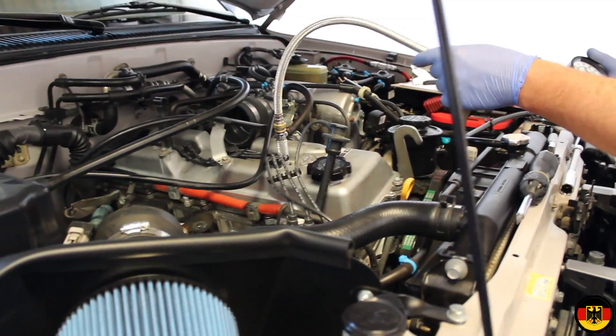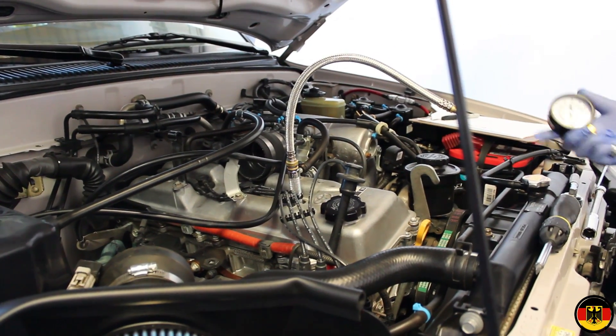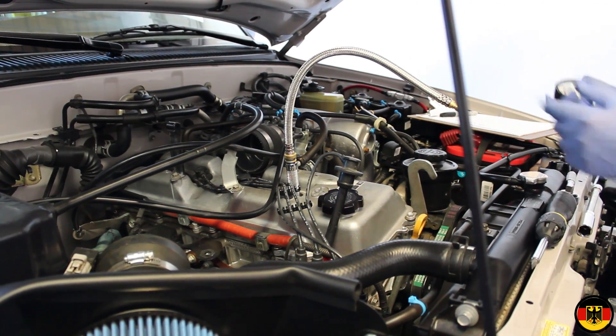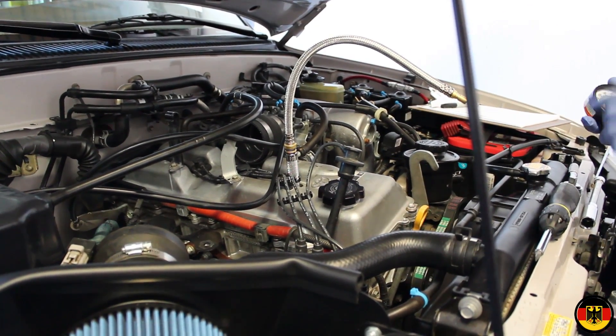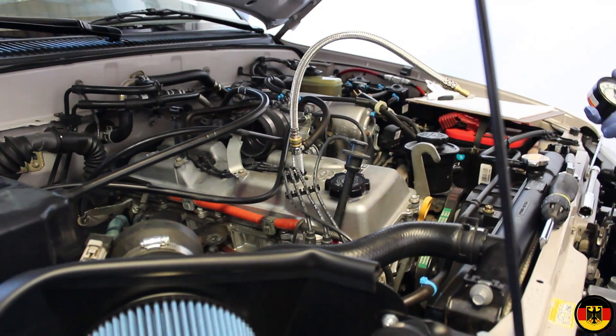On this cylinder, we got 120. We did it twice — the second time we actually got 118. So we went ahead and released it. I pulled this off and we're going to move to the next plug, but we're going to put the first plug back in first.